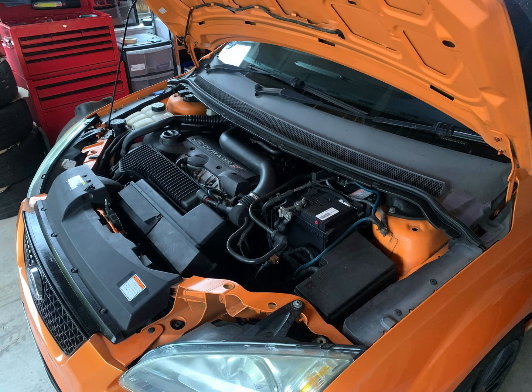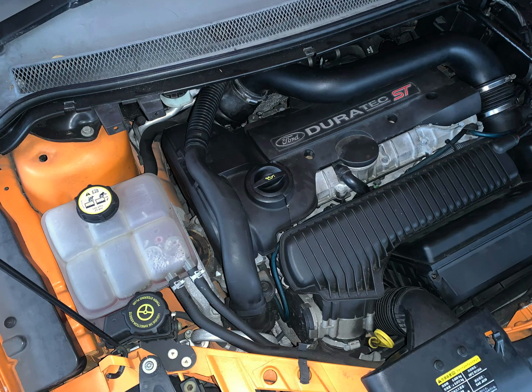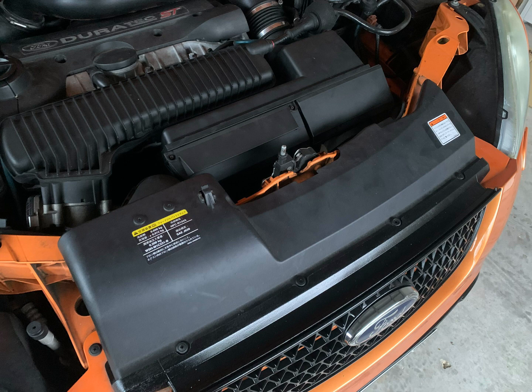So first thing I did was take a few photos of the engine bay before I started, just general area and some close-up details of specific areas. This was so I could use them as reference for when I was putting it back together. Then I removed this slam panel cover by removing the 6 plastic fittings. You can just pry those up with a plastic pry tool.